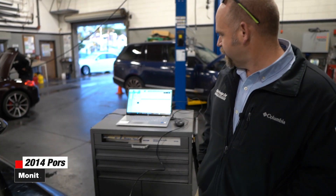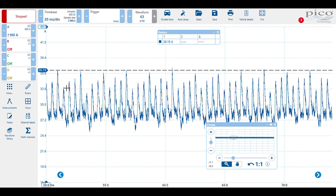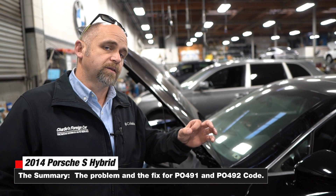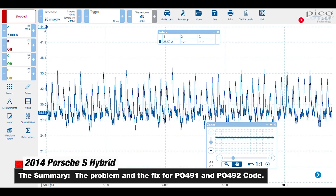The main thing we're watching right now is that the pump is running longer than 3.4 seconds — that's a huge win. I zoomed into this capture and you can see our highest peak lines are at 36 amps — few and far between. Our average, the deep blue line, is around 28 amps. That is much lower than what our deadheaded pump was. It's a tiny bit higher than when we disconnected the pipe, but we kind of expect that because we're running it through orifices smaller than the pipe size, causing some restriction. The lowest we got from an average was about 25 amps, so this 28.5 amp number is really good. I like this as a fix.